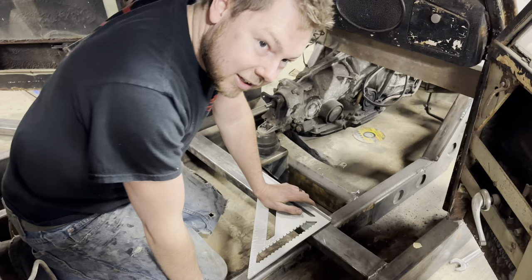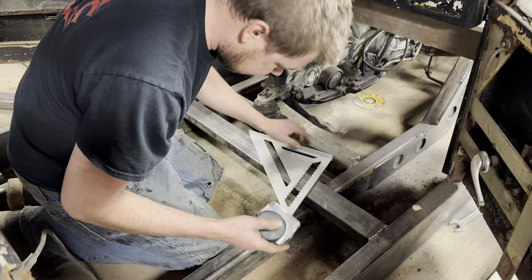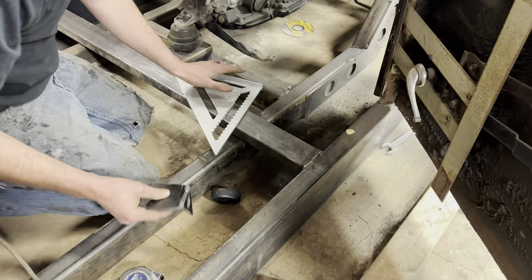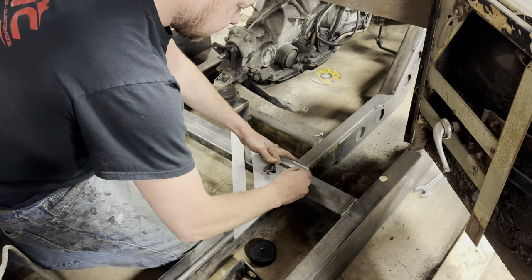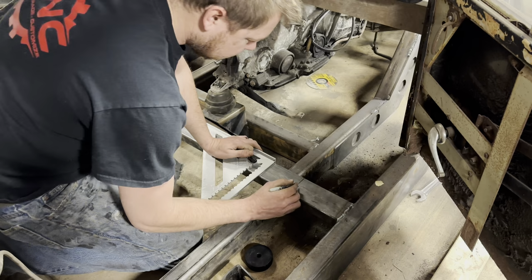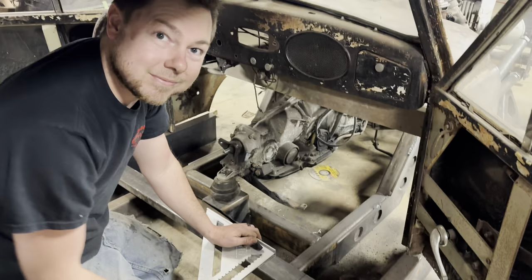All right. This puck is going on the bottom of this, just like that. And to find that hole, I figured I could come up here just like this, run this square like that, take a Sharpie. There's that, that's 3 inches, so 1.5 inches. We're gonna put a hole right here, and that'll fit it right here, but under there. That's the plan of attack.